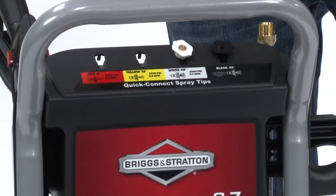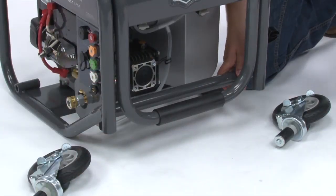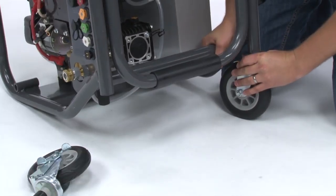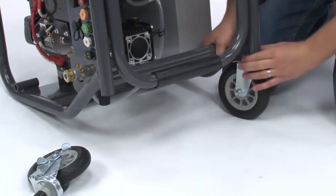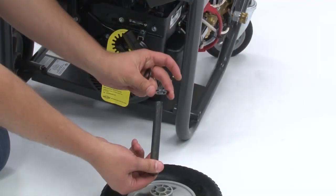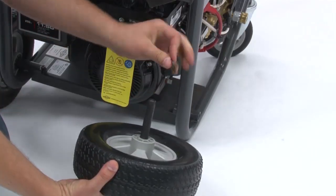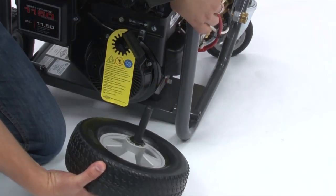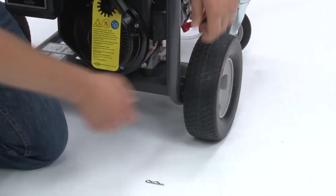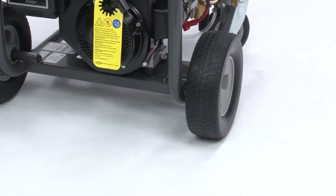You may have three or four spray tips, depending upon which model you have. If you have the four-wheeled model, install the wheels by lifting the corner of the pressure washer, sliding the caster wheels into the bottom of the tubing, and tightening the collar of the wheels to secure in place. Slide the flat washer, wheel, and another flat washer over the axle stud. Lift the corner of the washer slightly and slide the axle stud through the mounting bracket. Insert the retaining pin through the hole on the axle stud to secure in place. Repeat for the second wheel.